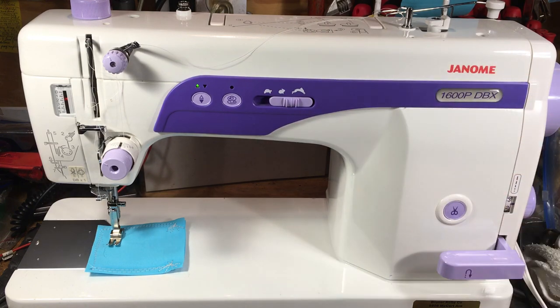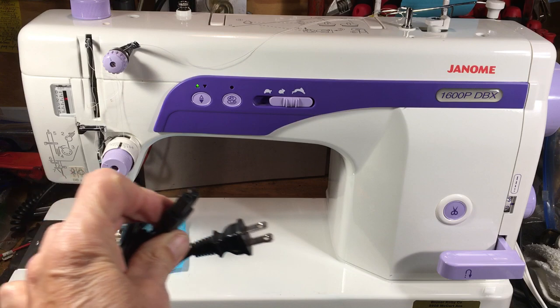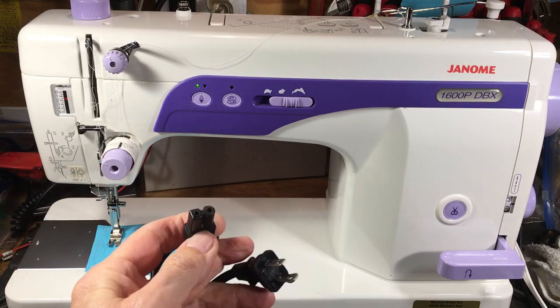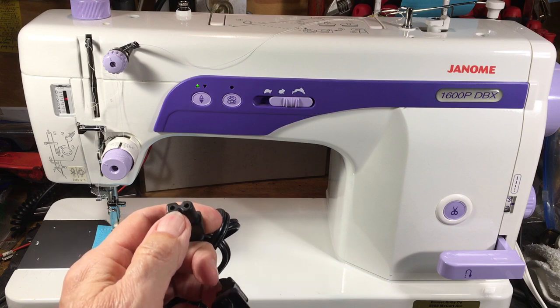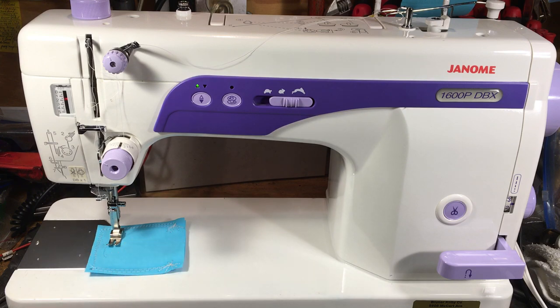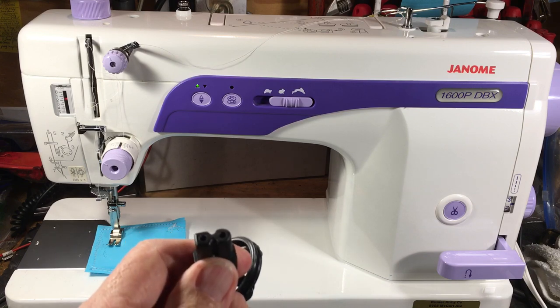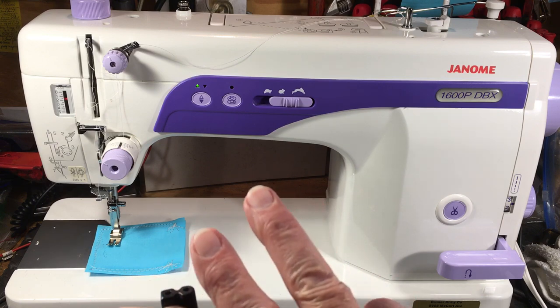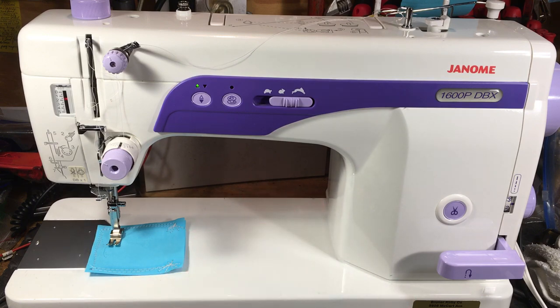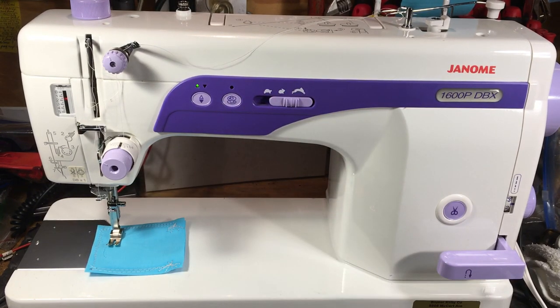As an aside for folks with Janome machines that have the separate little power cords on the side — always be careful with your plugs. A lady last month wasn't careful. These plugs aren't all exactly the same; the distance between the two prongs is sometimes slightly off. You might think two machines' cords are interchangeable, and often they are, but the time it doesn't work is when you plug in the wrong one and snap off one of those prongs. That whole apparatus costs about $180. Keep the power cord with the machine it came with.